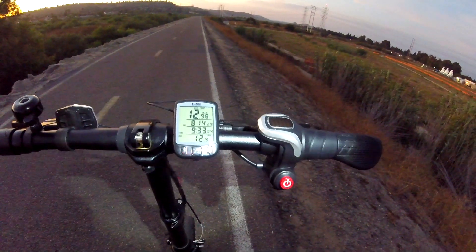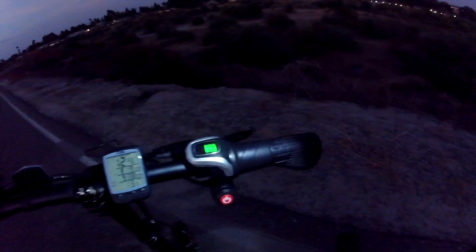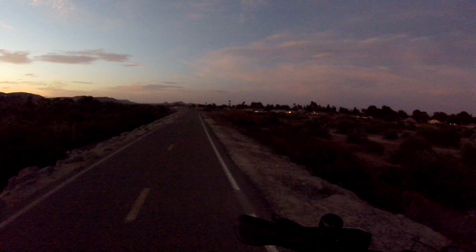Something must have gone wrong. I stopped the bike and tried to figure it out. I turned off the power and tried to turn it back on — nothing. The only way I could turn it back on was to disconnect the battery, which can only be done by folding the bike in half and putting it back together. When you fold the bike, the battery connector is disconnected; when you put it back together, it reconnects. So it's like resetting the controller. It did turn back on, but it only went a few meters and then turned off again. The battery was completely empty even though it showed three bars on the screen. I ended up pedaling home — it was dark, cold, and the bike has no lights. So the moral of the story is: when it shows three bars on this bike, your battery is almost completely empty and you need to be ready to get home on your own power.